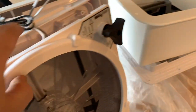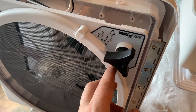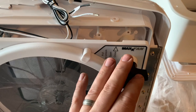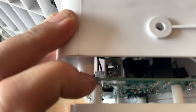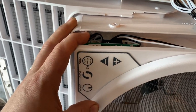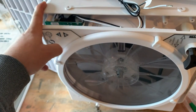It's got the controls and a manual knob. Part of the reason I stuck with that is: one, I bought two of these so it saved me some money; and two, if the electronic board goes bad — which it can — I can still operate this manually. If it's all electronic and goes bad, it's stuck open or closed. Also cool: there are RJ45 jacks to connect a wired remote, giving you all controls wherever you want. That's almost better than the wireless remote because the wireless is infrared — it needs line of sight — whereas a wired remote you can just do whatever you want.